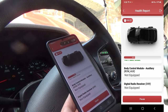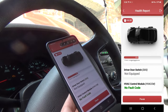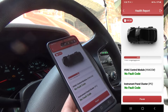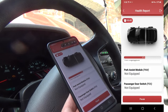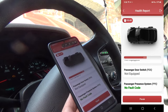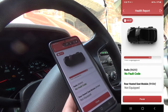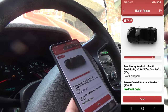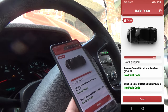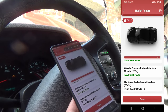The app will tell you what modules are not equipped on this vehicle. This is an all-systems scanner — my 2016 Sierra SLT has 21 modules and it scans all 21. It's got active tests and special functions for all the different modules that have those capabilities. It's not just four systems, it's not just an engine OBD scanner — this is a full manufacturer-specific scan tool. When I bought this it was $160 with a $30-off coupon, so $130, and I'm telling you it has the capability of my $1,600 Autel scanner as far as active tests and special functions.